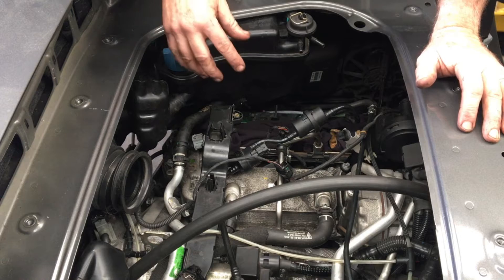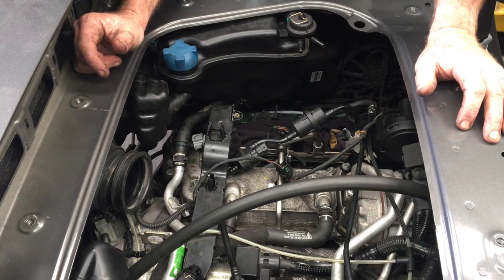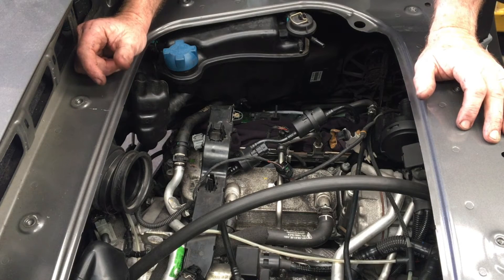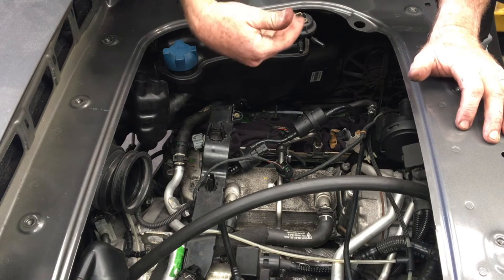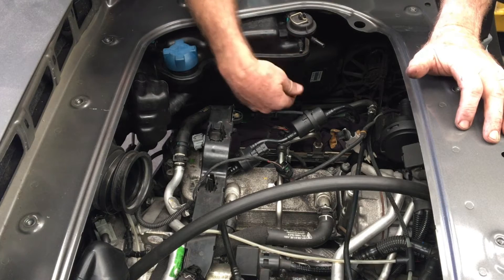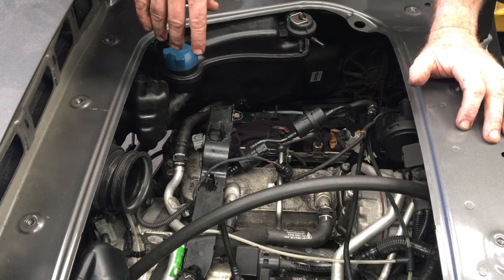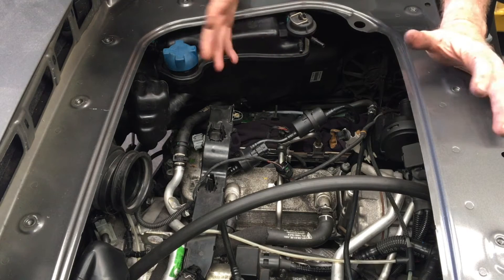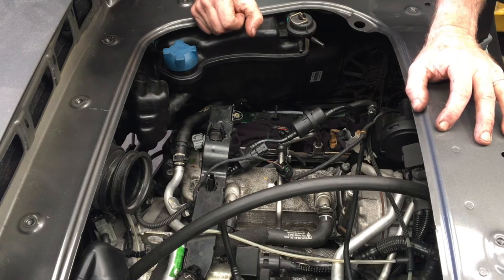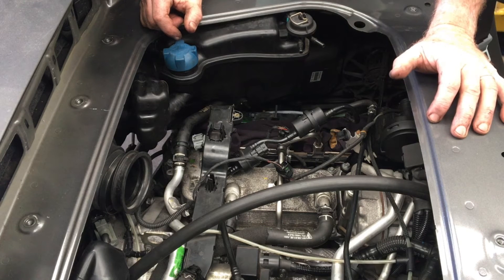To remove the expansion tank, the first thing we need to do is drain the coolant. Have a look at the video I made on how to do that and how to refill — I'll put a link in the description. Don't be tempted to just release a little bit of coolant, just enough to take out the reservoir, because when filling later it's going to make it more difficult. If there is any level of coolant in the system when you start to compress pipes and put it under a significant vacuum, it's really easy to start sucking it out of your vacuum tool. My advice would be to evacuate the system as much as you possibly can — it's going to make it easier to fill later on.